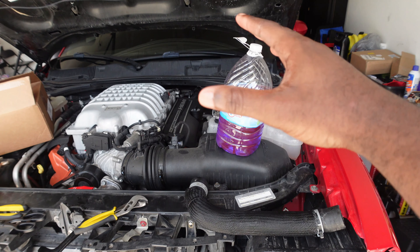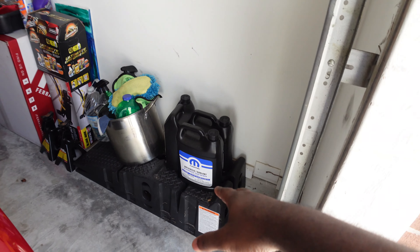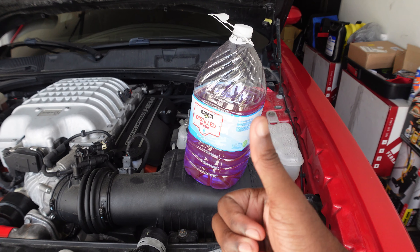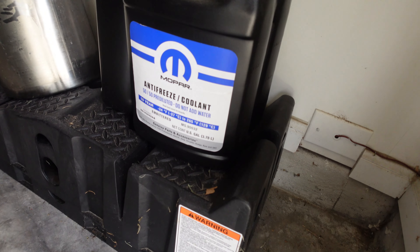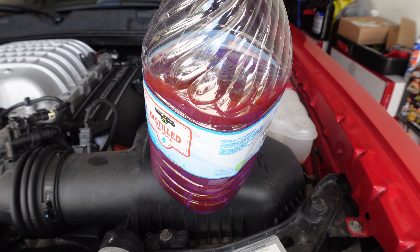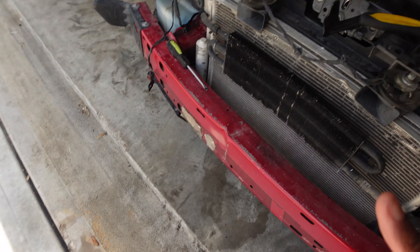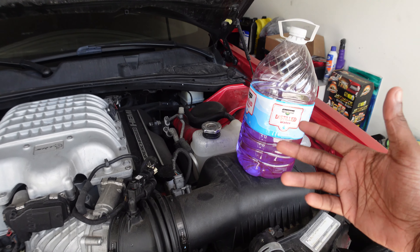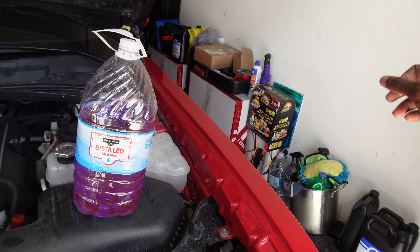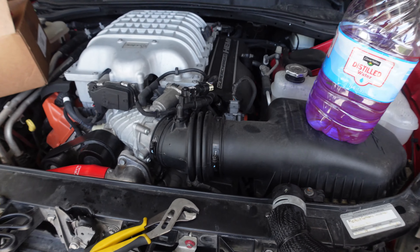Back when I first got this car, I put some coolant in and it was still overheating. I put straight 50/50 pre-diluted coolant and it still overheated, so I added some water and it worked perfectly fine. Now they do say do not add water, but the car was working fine. As I see it's a little orange in here, I'm thinking it's more water than coolant — that's why it came out orange. I'm gonna drain the whole coolant, flush it with distilled water, then put fresh coolant in and see how it performs.